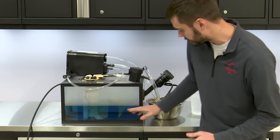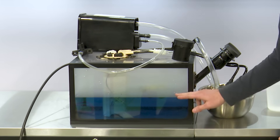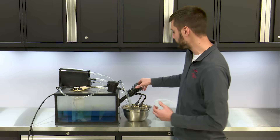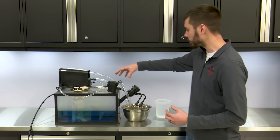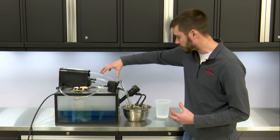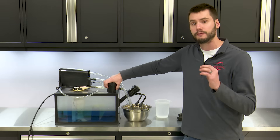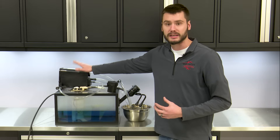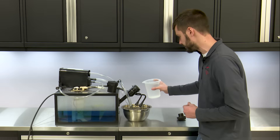We have gas here represented in blue. On top of that, we filled it up with smoke to represent all the air and fuel vapor sitting on top of the gas. What's going to happen when we fill this thing up is we'll force that fuel vapor — the smoke — to exit out of our normally open vent solenoid. But it's not hydrocarbons or fuel vapor leaving this; it's actually filtered air because it's gone through the charcoal canister first. Let's take a look and see what happens.